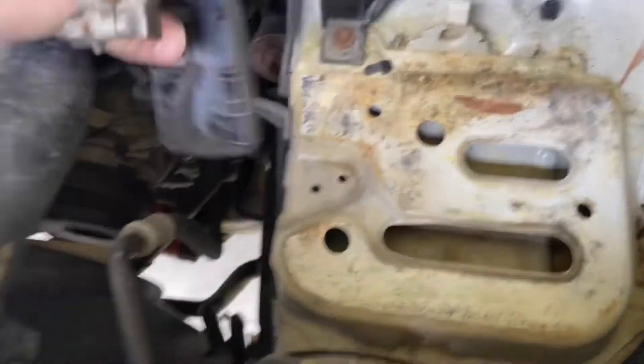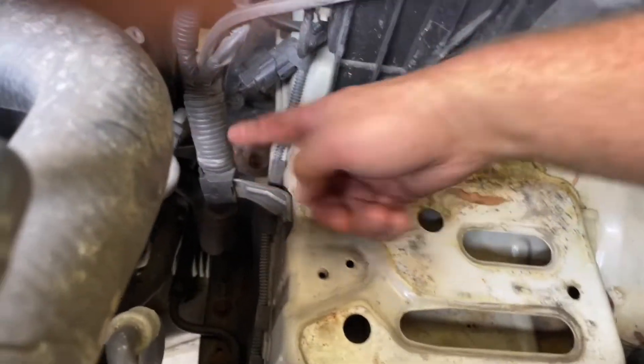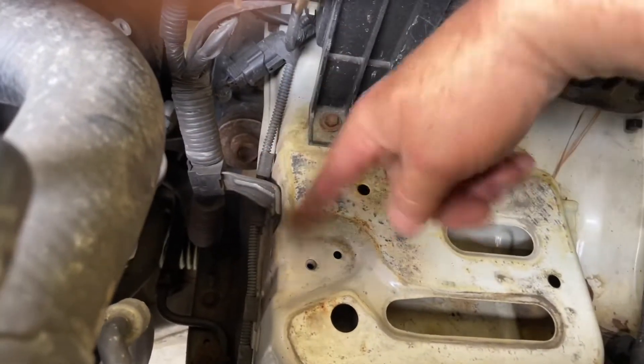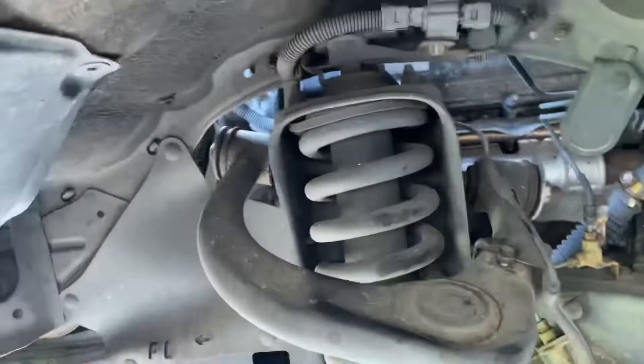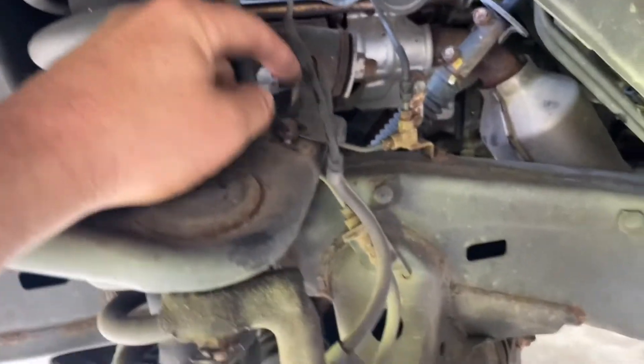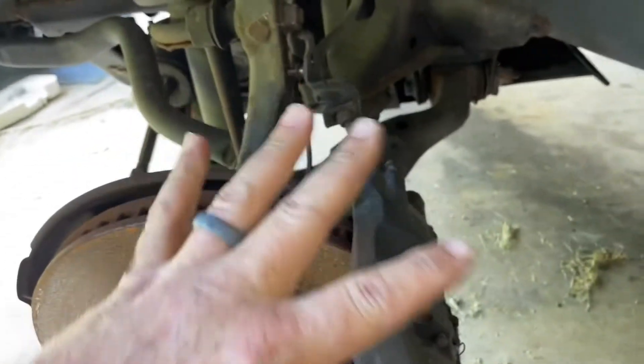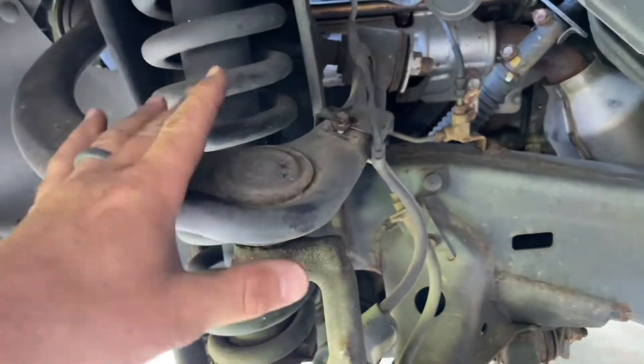Get your battery out of the way, get your battery tray out of the way. This is where that upper control arm bolt has to travel to come out, so we're going to take this off — I believe that's a 10 millimeter — and get this little brace out of the way so we can get the upper control arm out. You do not have to remove your strut or any of that. Take your brake line loose at 10 millimeters; I take it loose from here as well.